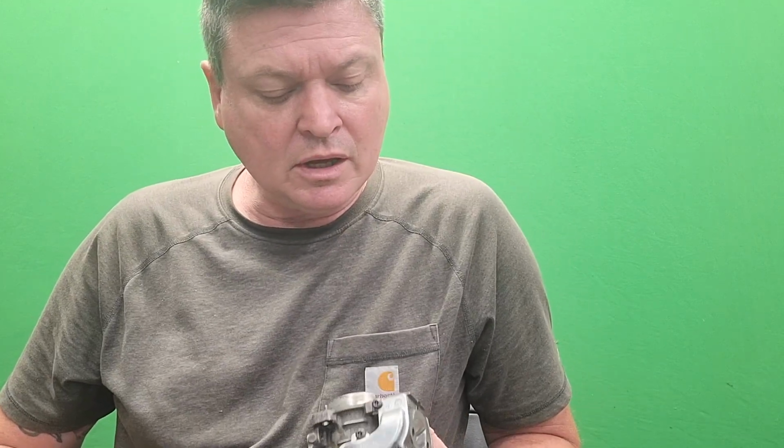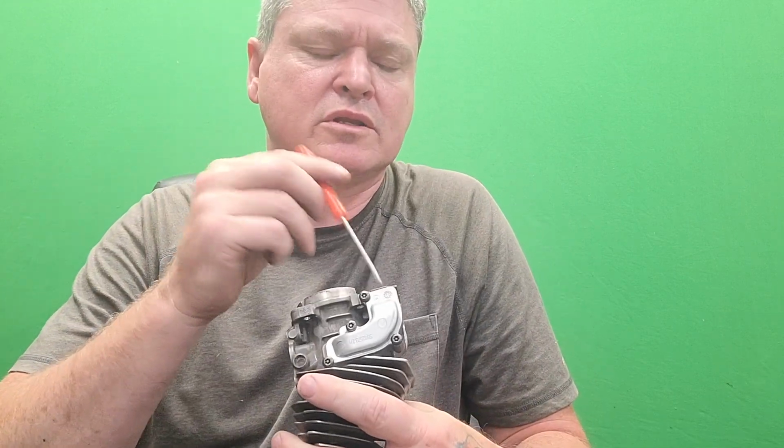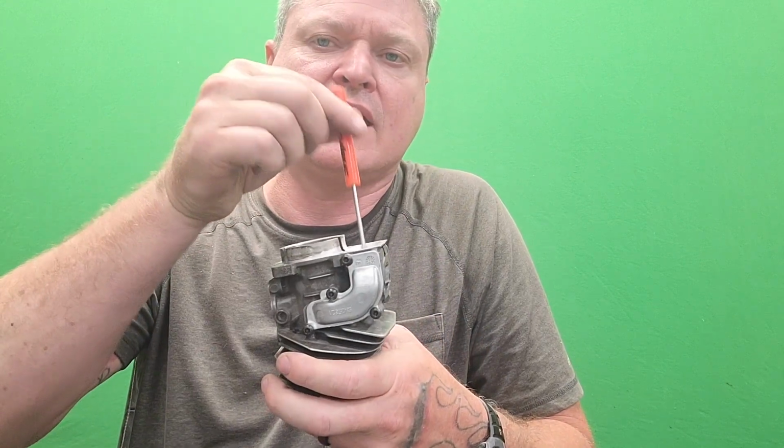Somebody mentioned that with cars, longer intake runners typically mean more torque, shorter intake runners typically mean higher RPM. And maybe they had those thoughts in their mind. Maybe that was why they wanted to slow it down, because they wanted this thing to peak horsepower somewhere around 11,000, 10,000 RPMs instead of 12,000, 13,000. I don't know. But they did it. But what Super Dave said, and I have heard this before, is that the reason the intake charge is over here on the exhaust side is to help cool that side of the cylinder. I don't buy it.